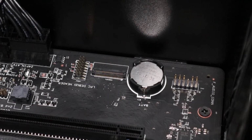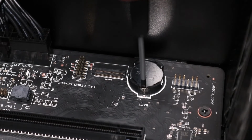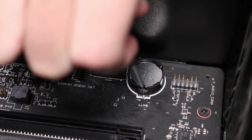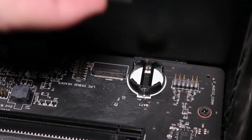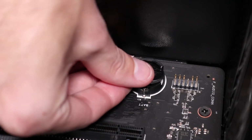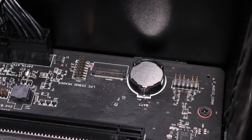Restore the CMOS factory settings first, before replacing the system motherboard. To do so, remove the battery from the motherboard. Wait 30 seconds. Replace the battery to the motherboard. CMOS factory settings are now reset. Note: you will now need to enter System BIOS and reset the clock in BIOS after this procedure.